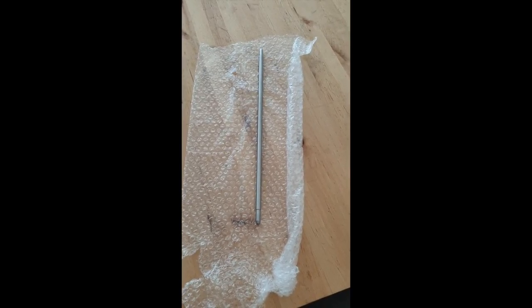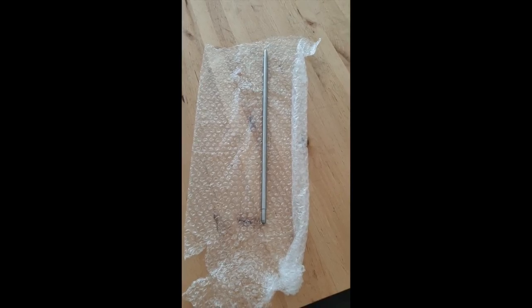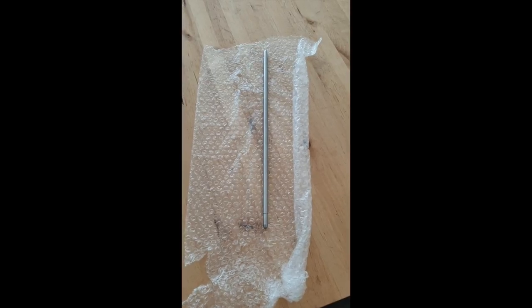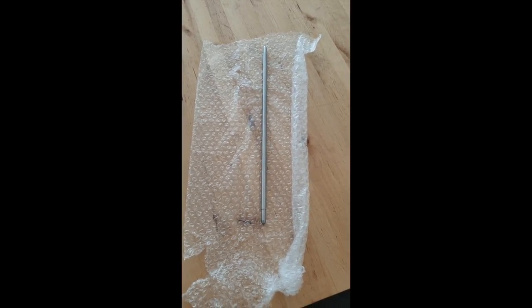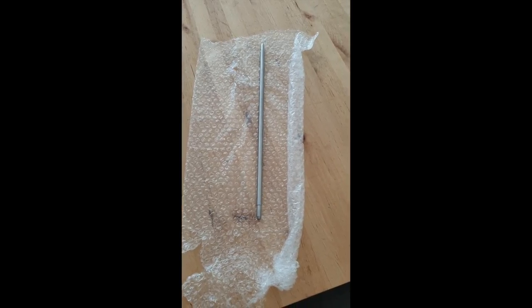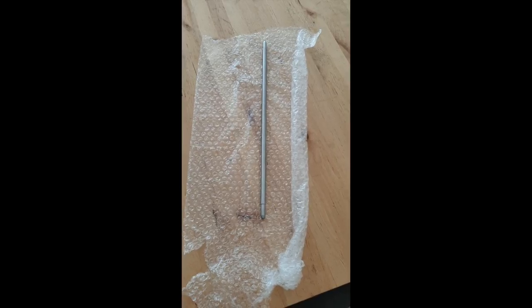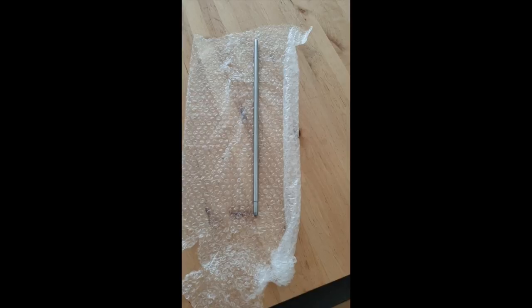I just got this and I'm going to go out to the bike. It's a 2019 Street Glide Special and I have the oil transfer problem. The oil from the transmission when I drained it was 0.5 liters, and on the primary side it was 1.5 liters, so it has transferred 0.5 liters to the wrong side.